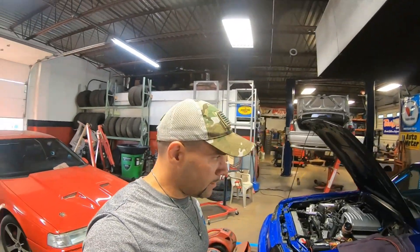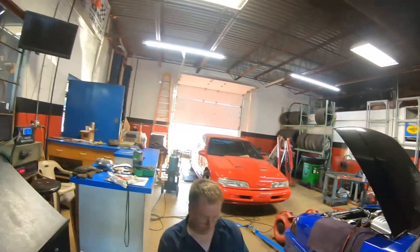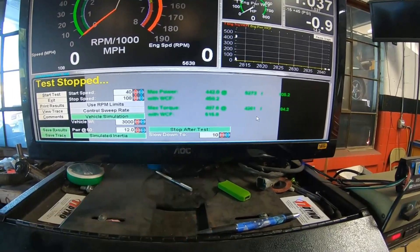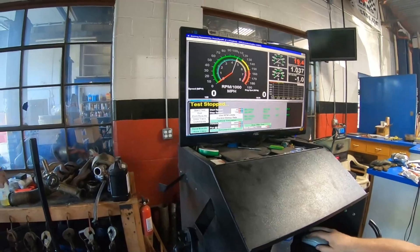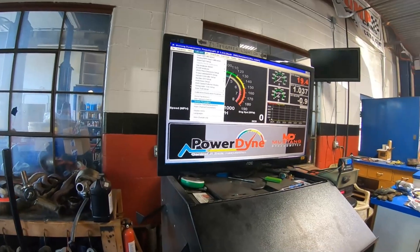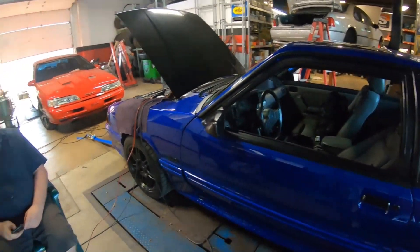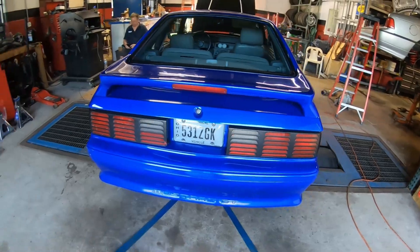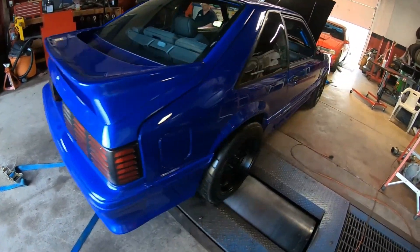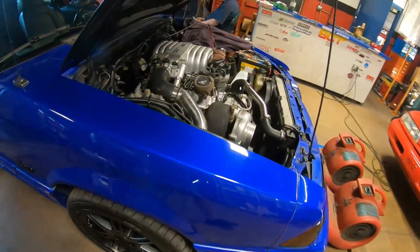All right, so we made our three hits. We did a little bit of correcting. We went up to about 14 pounds, which I ain't going to go any further. I'm pretty happy with that number. 458.5/515 is kind of ridiculous for a stock block. And this is a Mustang Dyno — weather correction is 85 degrees, 52% humidity, weather correction factor, no cheating. Loaded 3,000-pound Dyno. If you guys see me back here in the wing, I was trying to hold the damn thing down. We made a clutch adjustment. She makes power, fellas. I don't know how she holds like that, but she does. And they said it ain't so — well, that's where it's at.